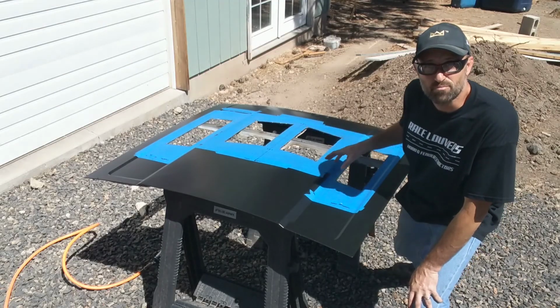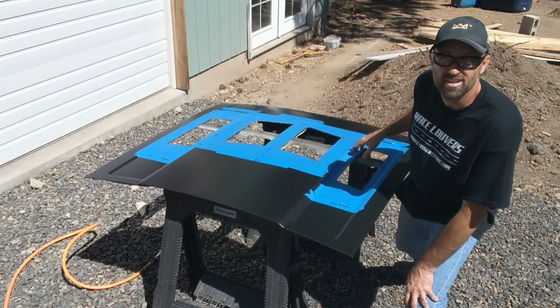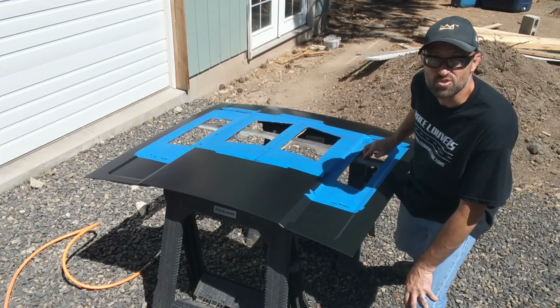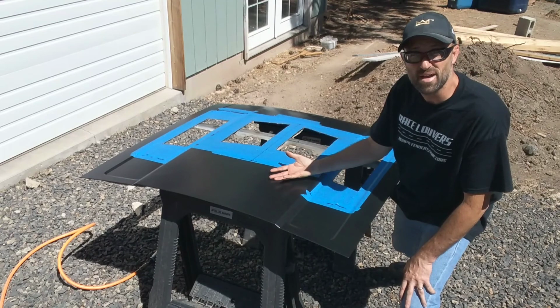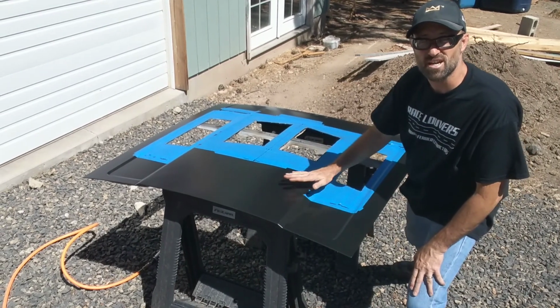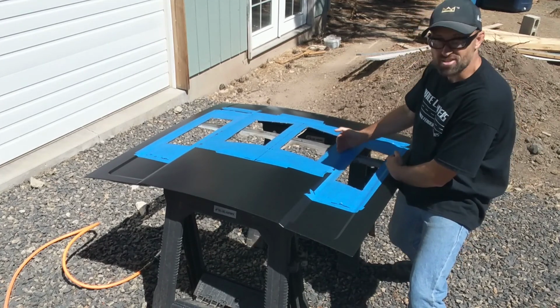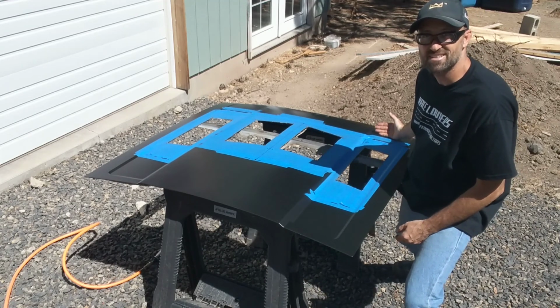All right, so once you have both sides of your side louvers opened up on the hood, you can then work to flip the hood over to get rid of the inner structure. So with these, just flip them on. I would put the blanket back on, turn it back over that way you don't worry about scratching the top surface, and then you can worry about recessing these back. Remember, 1 inch on the sides, 1 inch on the back, and 2 inches on the front.